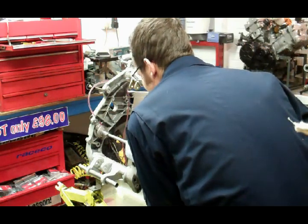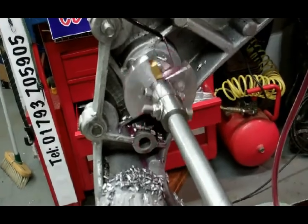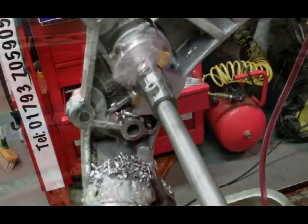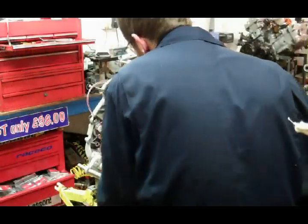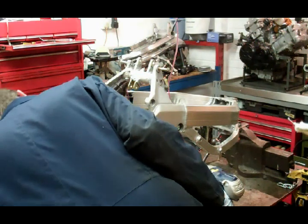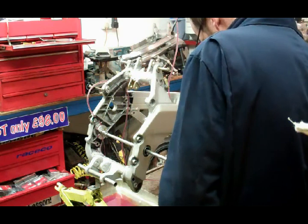That's all I'm doing now — just cutting down the frame. You can see lots of lovely swarf; the brass is rock hard carbide cutting the frame down. Done it on both sides: 5mm on one side, 5mm on the other — wide enough to get the swinging arm in. Once I've done that, I need to make a spacer to help get the swinging arm in exactly the right place.